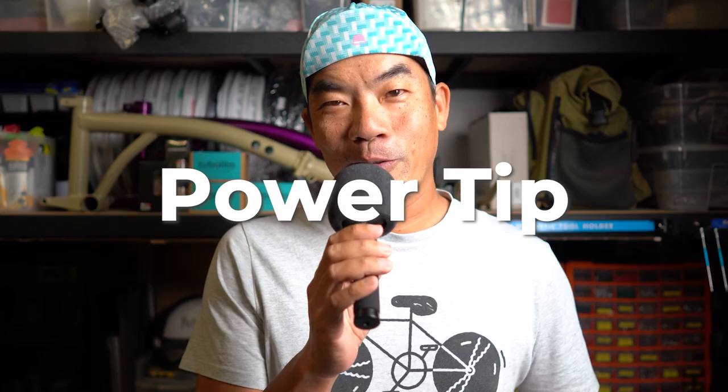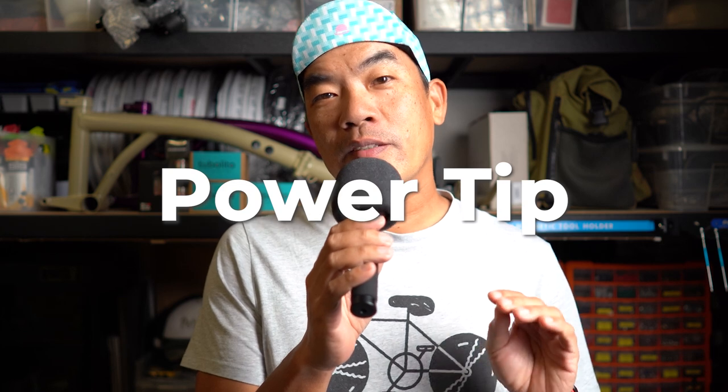Okay, let me give you a power tip. I genuinely run on this rule whether to fix just the broken spoke or have the whole wheel rebuilt with new spokes. If you have three or less spokes broken from the same wheel over its lifetime, you can just fix that particular spoke. But once you count up to three — starting from the fourth — you should consider rebuilding the whole wheel set with brand new spokes. That's my power tip.